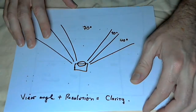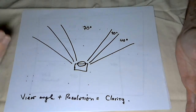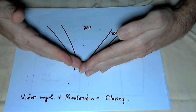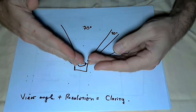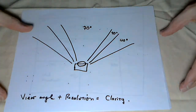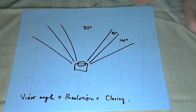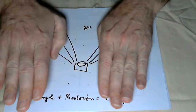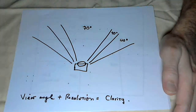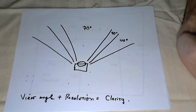If you look at certain action cameras, that's a big thing when you watch a lot of those videos from GoPros and things like that: the cheaper ones will have a really wide field of view, very similar to, say, a GoPro. But the GoPro has a very large resolution behind that and can actually help adjust, and will do image stabilization, and will do a little bit of contouring of that image to give you a flatter image, to get rid of that distortion and give you a really nice, wide, high-def, clear view. Cheaper cameras don't really do that.